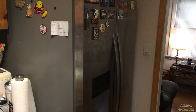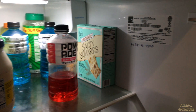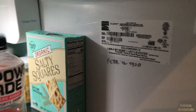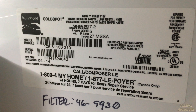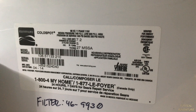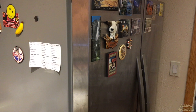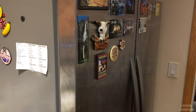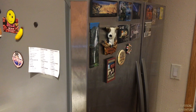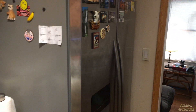I'm going to attempt to run this residential-style Kenmore refrigerator. It's not the most energy efficient — about five or six years old. At full load it pulls 7.2 amps. However, there's an important footnote: refrigeration systems use a compressor, and when the compressor starts it actually pulls a lot more amperage. Many newer refrigerators and residential air conditioners include a hard start capacitor to manage this — though some have smaller ones or none at all.